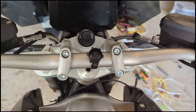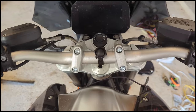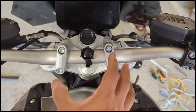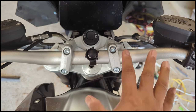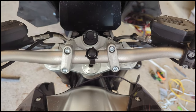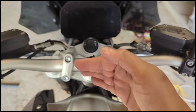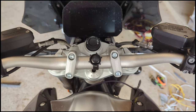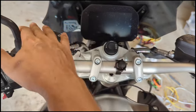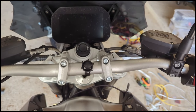This is how it looks — perfect fit, everything tightened down, bars exactly centered. Remember I made those two black marks which fall right under here — that helps you center it. When you originally take everything apart, don't move the bars; take a sharpie and mark it. It makes it so much easier to position left to right and gives you perfect centering for the up and down angle. You can adjust it as you ride. Cables are not pulling, everything's perfect — we're good to go. Hope you enjoyed this video, like, comment and subscribe. Thank you!